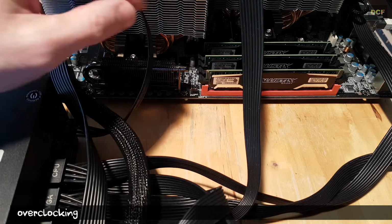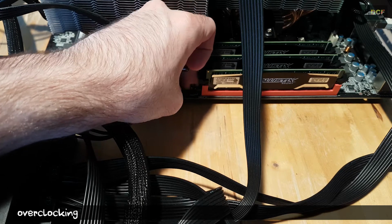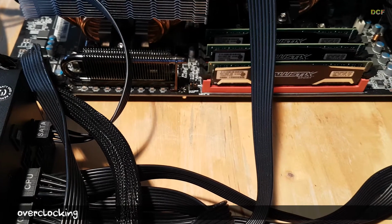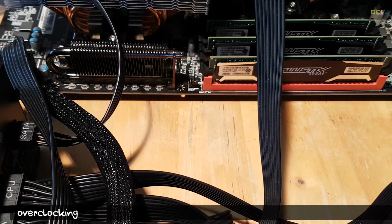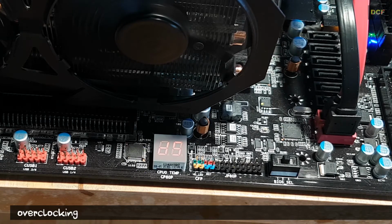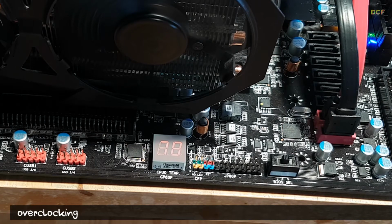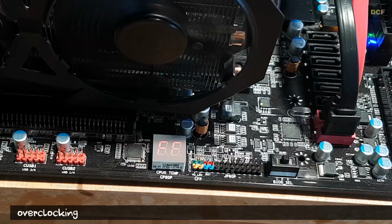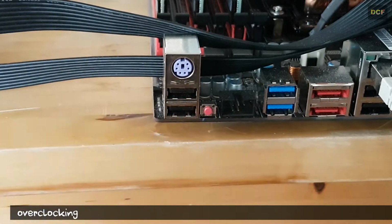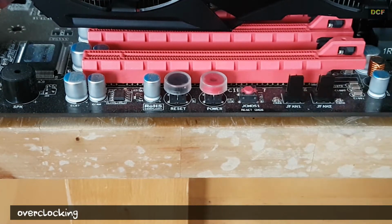During benchmarking I had another strange issue. This board has a very nice feature. You can deactivate each CPU separately and don't need to take out the CPUs to make a one-CPU benchmark. But when I shortcut the jumper and deactivated one of the CPUs in overclocked state, the motherboard would post with FF. More strange is the fact the board showed FF during the Windows boot, and then it froze. On one occasion the board showed FF and Windows ran perfectly fine. I solved this problem by clearing the CMOS and overclocking it with only one active CPU with the same settings like in dual CPU mode. Then the board worked like a charm.